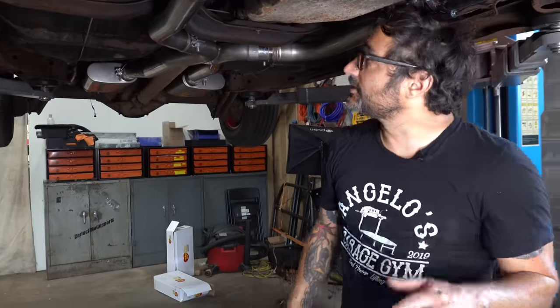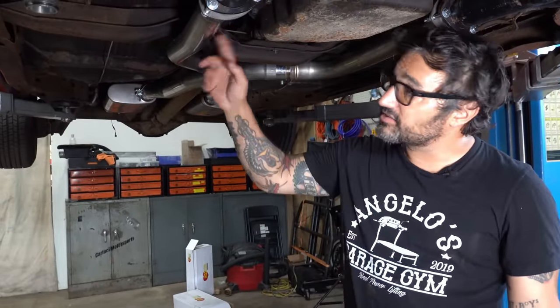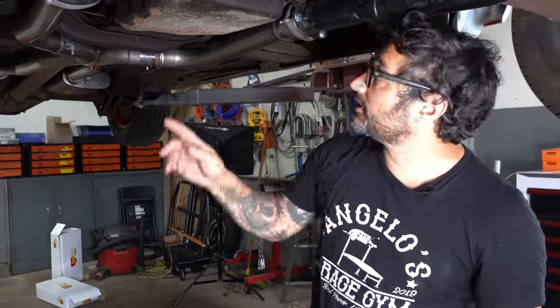All right, Michael and Denver got the exhaust all wrapped up. This is a Hooker stainless 2.5-inch kit that came with the car, so awesome. It looks killer, it seems to fit really well. I threw a nut on the trans mount, so we can knock that off the list. It's really only a few things to get it pushed outside and fired up, so we can maybe break the cam in and tune the carb, see how it's going. Dipstick, finish wiring up the fans, and deal with the fuel system. So that's where we are.